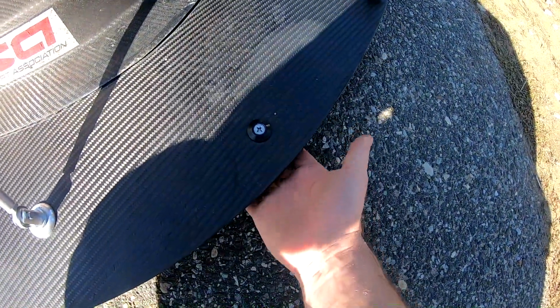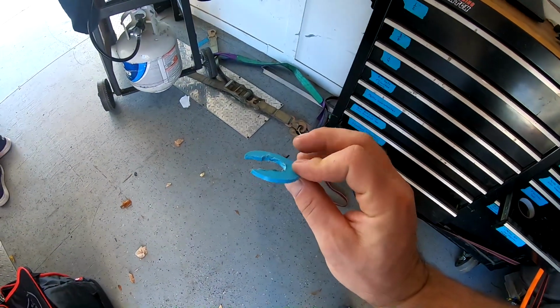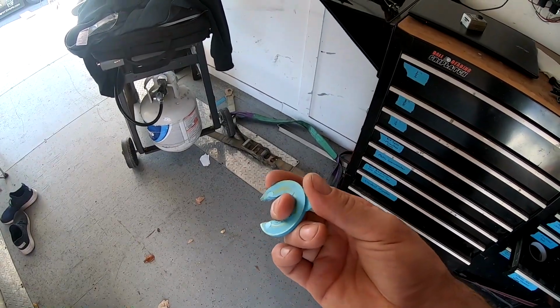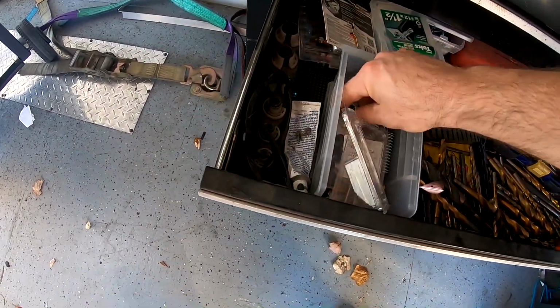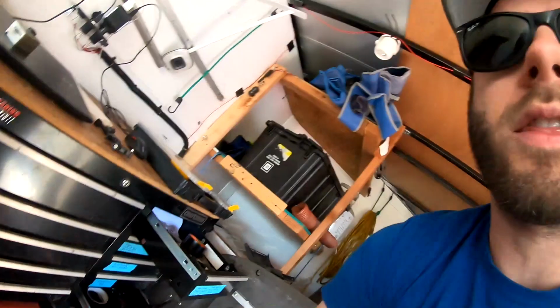The car was kind of porpoising into one, or the track is just bumpy. So I'm going to redo the splitter biscuit. I always carry extra splitter biscuits, and I can feel this one's getting a little bit thin. These are shock shims. I'll put another one up on the front left, just to keep the car from being able to go so low. And I'll put in some splitter biscuits, which, watch, I probably don't have any, here you go. These protect the bottom of the splitter, and that is about all the changes I'll make before qualifying.